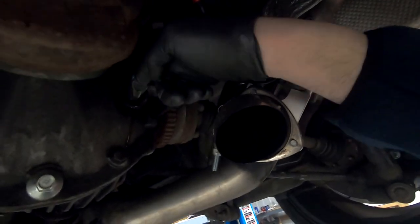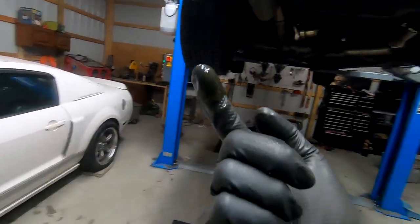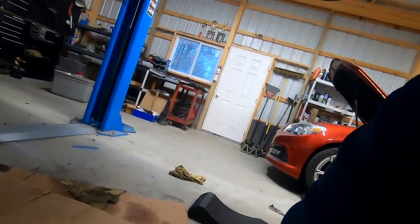After I ended the video, I decided to go take the plug out of the differential just to check the fluid. What's crazy is the fluid actually looks pretty good — it's high and it's still clean. The fluid is still clear from the last time I changed it. So I think this differential is just on its last leg. I thought for sure there'd be no fluid in it, but the fluid looks good. I think I'm going to have to go with a rebuild definitely.